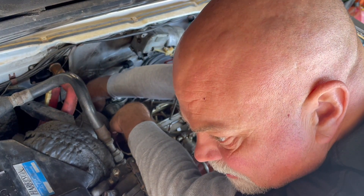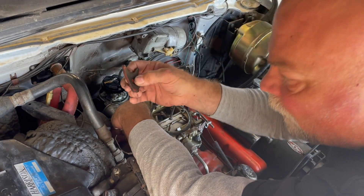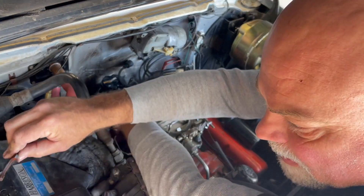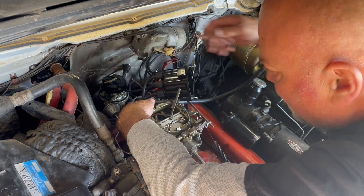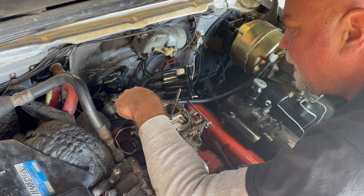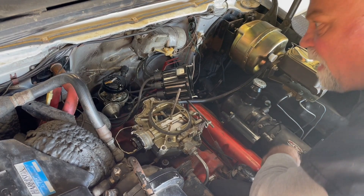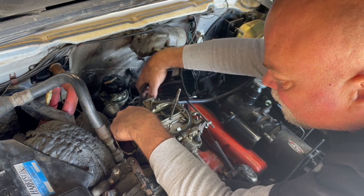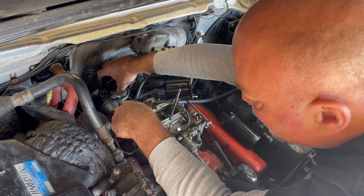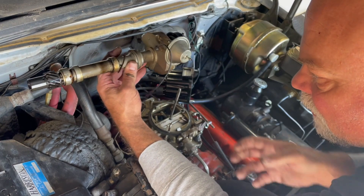I'm going to reach down and take out the rest of that bolt and show you what it looks like along with the plate that holds it down. This is the plate that holds the distributor in place and the bolt that was holding it in. Now, simply pay attention to where this rotor position is — it happens to be pointing in a pretty good direction. I'm going to spin the fan just a little bit to position it straight across and take note of that so I remember how it goes back in. Quite simply, you give the distributor a little twist and tug and the whole distributor slides straight up. That's it — your distributor is now out.